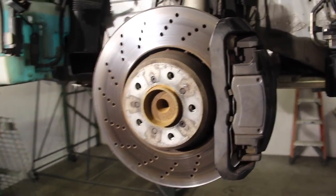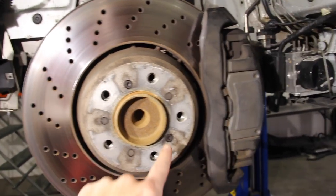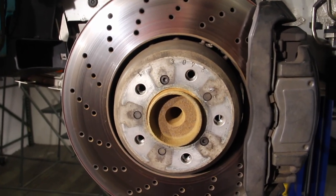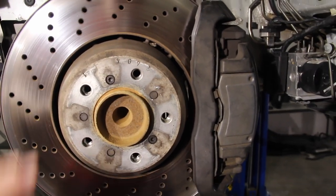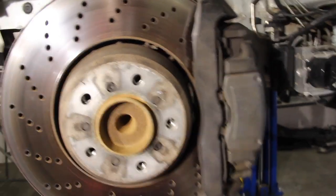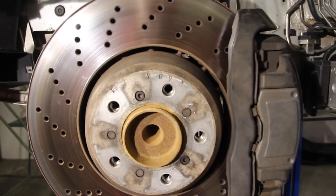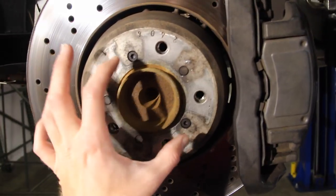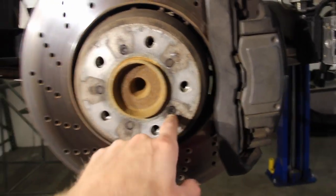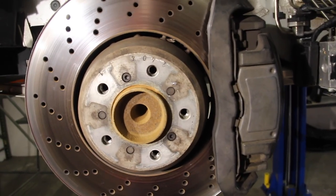Regardless of if your car is a California car or an Ohio car or whatever - worse on the East Coast cars - these two bolts here are your rotor set screws. Once the wheel is on, they really don't do anything, but until the wheel's on, it does hold the rotor onto the hub. So we want to hit these with some penetrating oil - PB Blaster, WD-40 works in a pinch - spray them a liberal amount and then give it some time. What happens is these get seized in here and they're really a problem because these are a hex head, maybe 5 or 6mm, and you put a tool on that and it just rounds. And now your rotor's stuck on, so you've got to drill it out. Ask me how I know.